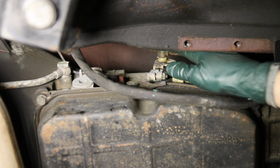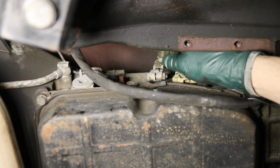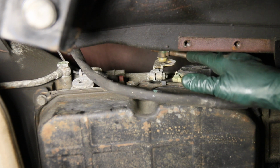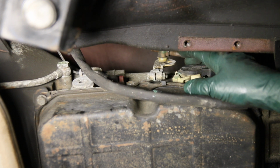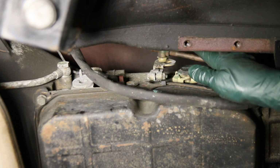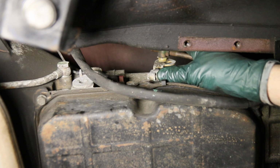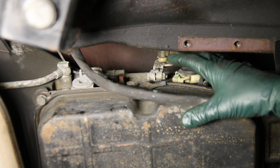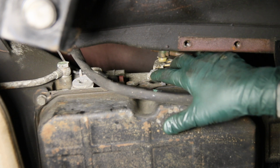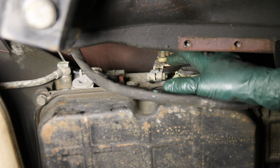The clip is on the inside. On a lot of the cars, the clip's right up here, and you can get the tool and get the clip off, but the clip is hiding on the back side, and it's literally impossible to get that clip off with this type of arrangement. So what I'm going to do on this particular R107 is remove the shift arm. Now it is notched here, so you can't get it on wrong, so you don't have to worry about getting it off and getting it on wrong. But I'm going to go ahead and pull this whole lever off the side of the transmission. I'm going to remove this 10 millimeter bolt, and the bolt has to come all the way out. I may have to spread this a little bit. I'll pull this off, and then I can go ahead and just replace the bushing right on the bench.